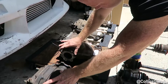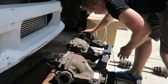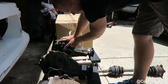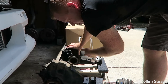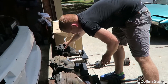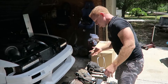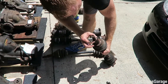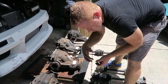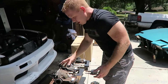In order to run either the 91-96 Q45 or 350Z axles, you need a 6-bolt stub shaft going into the differential. Several companies now adapt the 240SX 29-spline axle — they cut off the end, reweld a plate, and machine it concentric. We're currently running those in our 240SX differential with one Q45 driver-side axle and an R32 passenger-side axle. When you run those larger Q45 axles, they are actually 30-spline, so you get a bigger shaft and one more spline, which helps hold down the power.